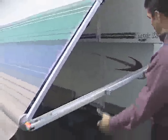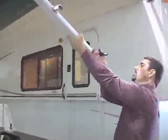With each arm, extend the inner arm until it locks into position, then tighten the locking nut on the inside. The last step in putting your awning up is to release the locking mechanism for the outer arm, raise it to the desired height, and let it lock into position.